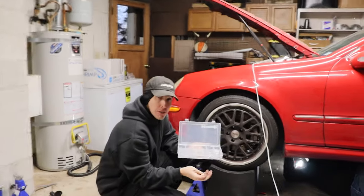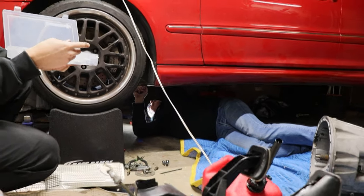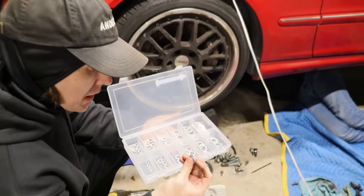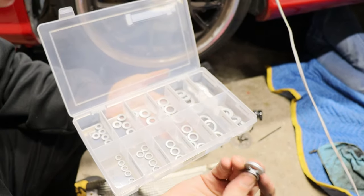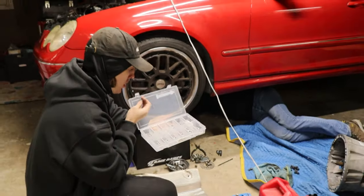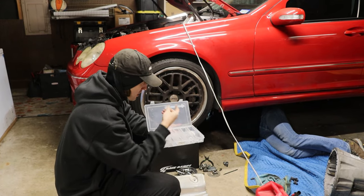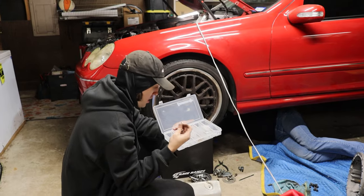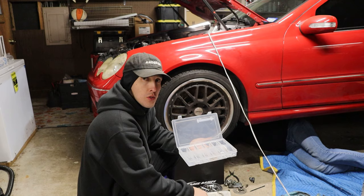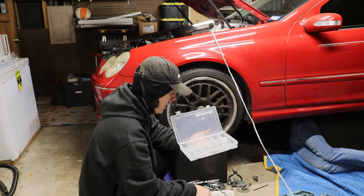All right, guys, we're trying to put the flywheel and starter ring in right now. Test fitting the bolts, so the bolts are almost the exact length, and we're worried about actually torquing them down, so we're test fitting with these Nordlock washers. Shout out to Bellmetric, they sent me these for free for winning something on Instagram. We're test fitting to see what they feel like with a washer behind the bolt, and if not, probably gonna have to do what we did the last 2 manual swaps and make our own flywheel bolt length by cutting them down. So we'll see.